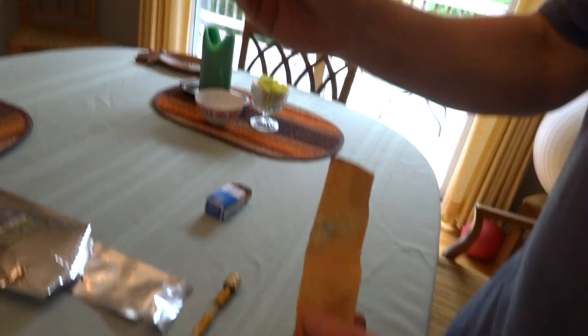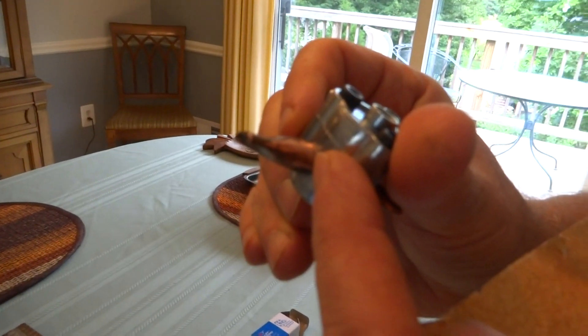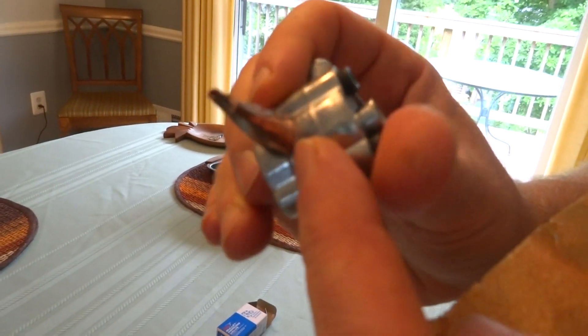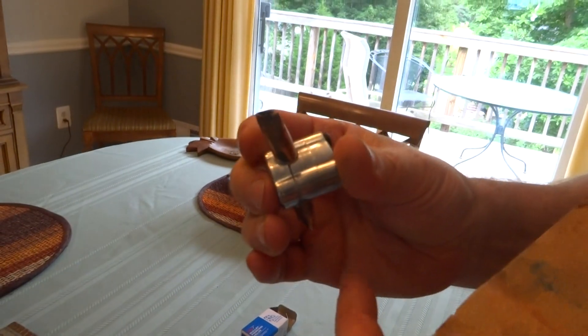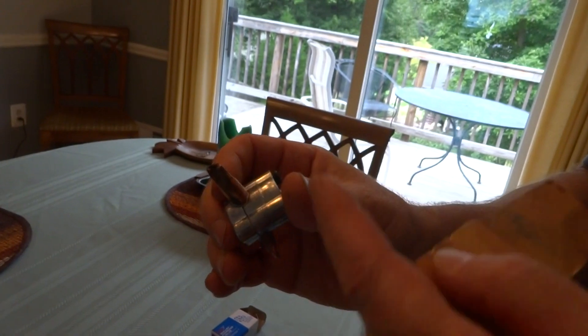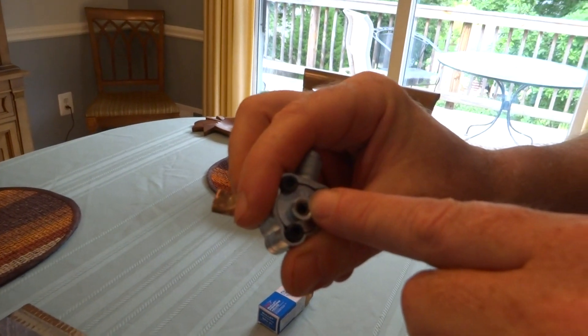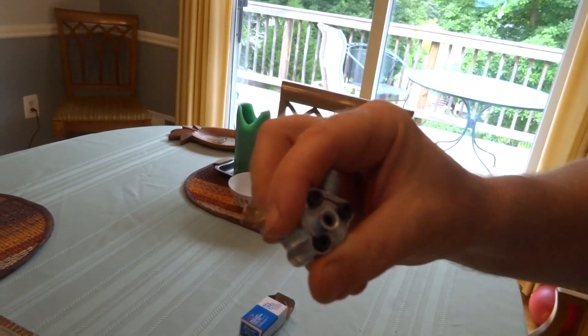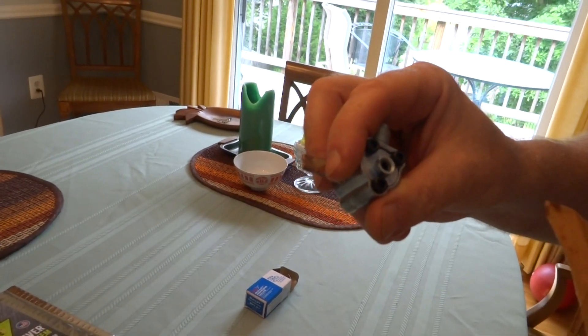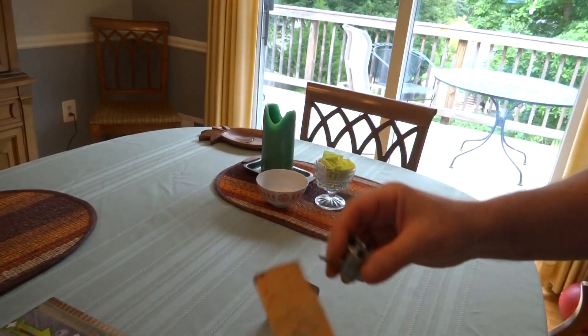See how it's polished? That's just to get any impurities off the copper. Because when you pierce the copper with the piercing screw, you don't want to inject any junk into your fridge. So that's why you sand it with the paper.